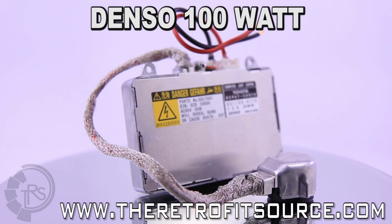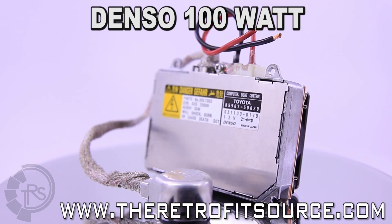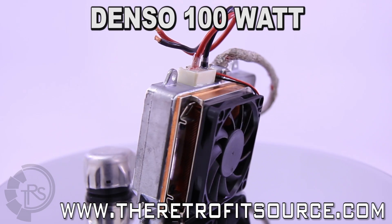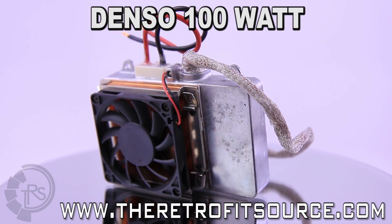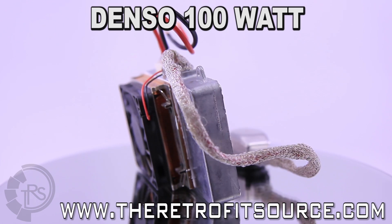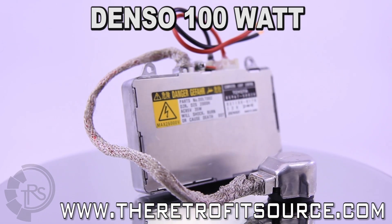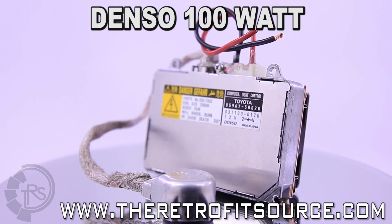With all of this good, what about the bad? The setup is not waterproof on its own, so it should be mounted in a well-protected place under the hood to avoid moisture damage. They are not recommended for everyday use. Because of their high output, we recommend OEM-quality bulbs, or at least aftermarket bulbs rated for 50-watt-plus to withstand the boost. Please note, bulb life expectancy is expected to be cut in half. Since these ballasts are specially made to order, please allow one to two weeks for delivery.